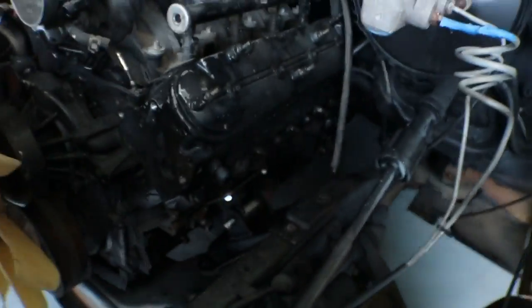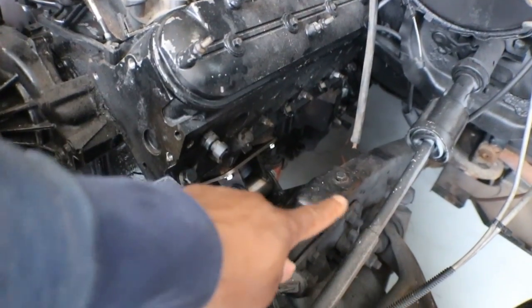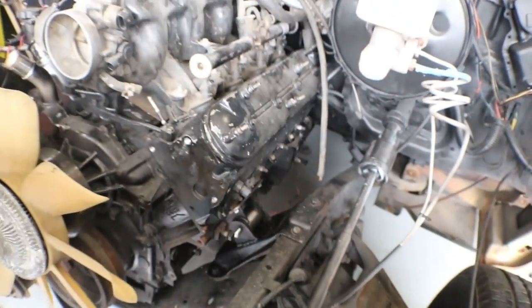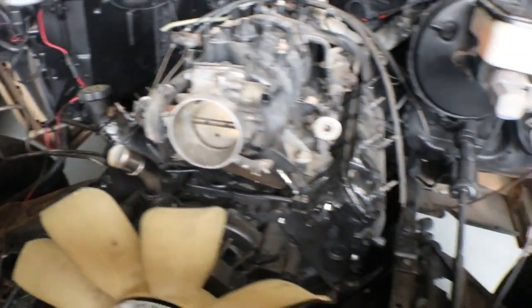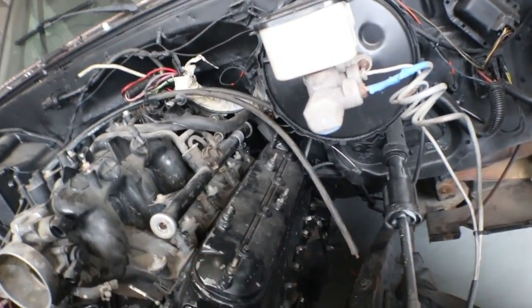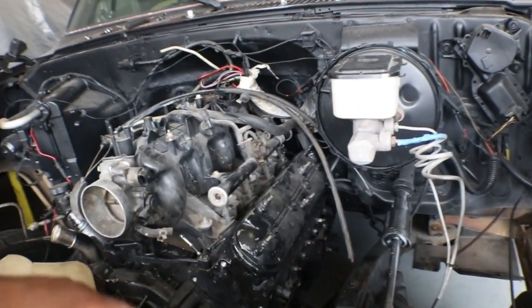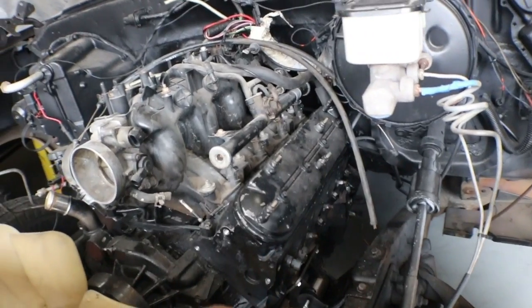So I'm going to tighten all this up. I had to move those a little bit but you can't even really tell. Tighten all that up, tighten the motor mount bolts. Then I put the accessories on. I got to extract some broken studs off the heads — they're all on those heads — so my MIG welder should help me out getting that stuff out.